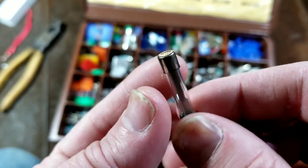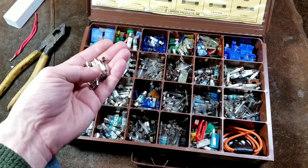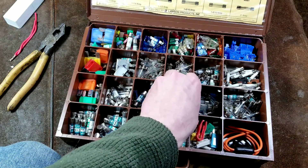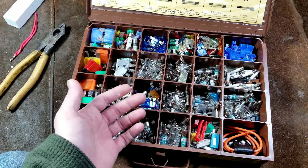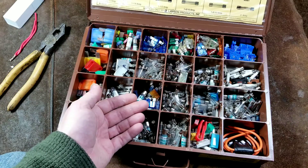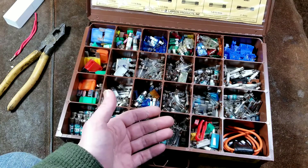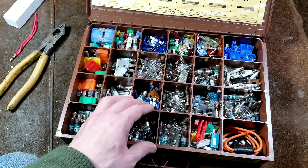The amperage is stamped on the ends — such as 30 amps — because that is such a critical aspect. If you ever run into a fuse that you cannot read the markings on, then you have no idea what it's rated for. It becomes real dangerous when you have too large of a fuse in a particular circuit: if it requires a 5-amp fuse and you put in a 10-amp, that will work — however, whatever may have blown the 5-amp fuse, when you replace it with a 10-amp, will result in a fire. And that's the whole point of fuses: to prevent fires and damage.